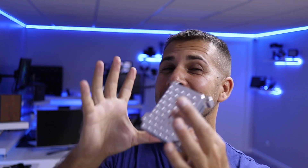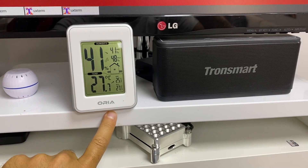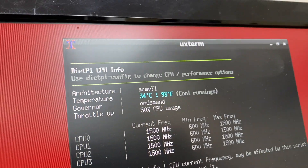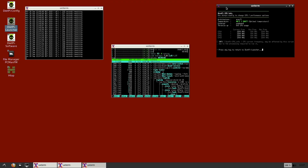I was curious about this case because before I started my test I thought: this is a huge passive dissipator — no fan, just the cooler itself. Your results will depend on room temperature: colder room means colder temps. My room was 26°C for the first two cases, and 27.7°C — about one degree warmer — when I tested Tony De Salvo's case. Even so, the maximum I got was 45 degrees Celsius. The difference is just huge.